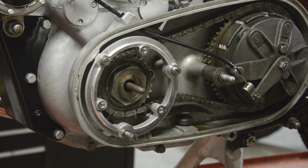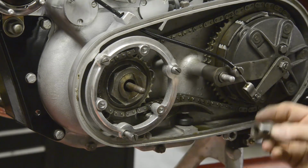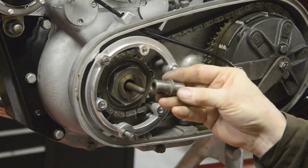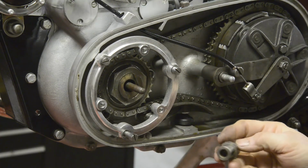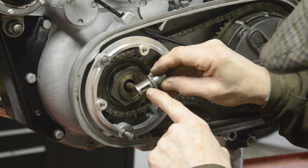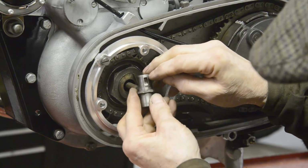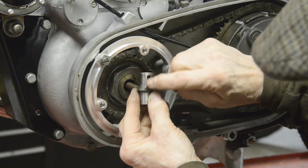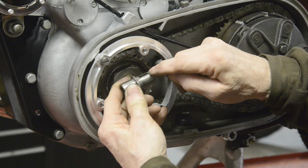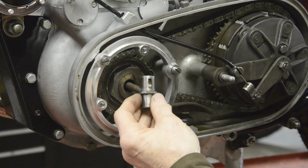So I ordered a couple of keys for the older engine and the newer engine and what have you, and they're all coming out the same size to fit this, so they're a loose fit in that. So what I'm going to have to do is get a key for that, and then hold it in the vise and mill off a little bit on each side of the key, so that the bottom curved part of it is going to be the right size to fit in there, and the bit that sticks up to go into the keyway in the rotor will be the slightly smaller dimension.